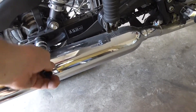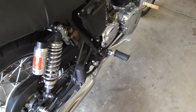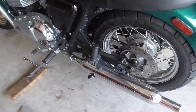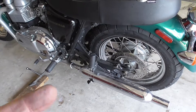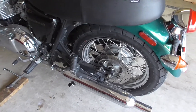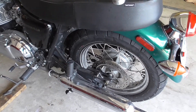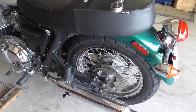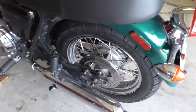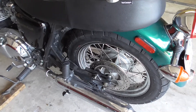But look — I can get there. How? Let's go around this side of the bike. Something's missing — the shock on this side. I took it off. So it's only supported by one shock on the other side, and that raises the axle just above the level of the muffler — close enough that I can force it on. Now I can loosen the axle, do the adjustment, make the alignment. Bob's your uncle.